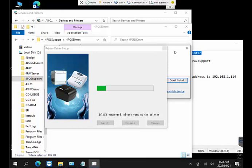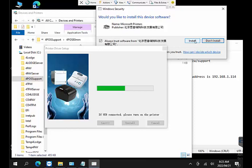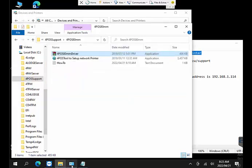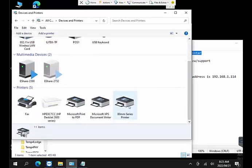While the installation is running, you'll see a small screen pop up in the background asking you to confirm that you want to install the driver. Just move it aside so you can click Install, and within seconds the driver will be installed. Now let's go back to Control Panel — Devices and Printers — and you'll see the printer is now listed there.